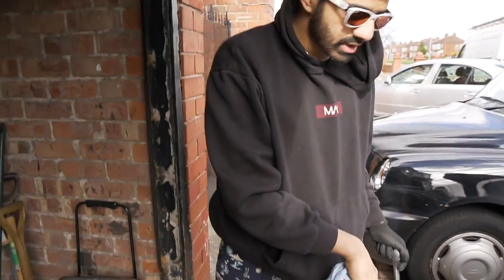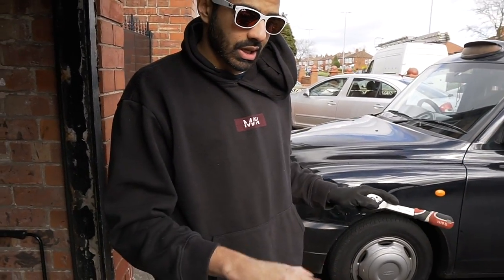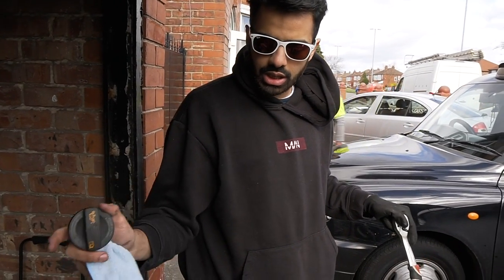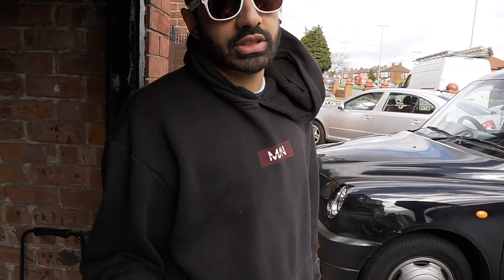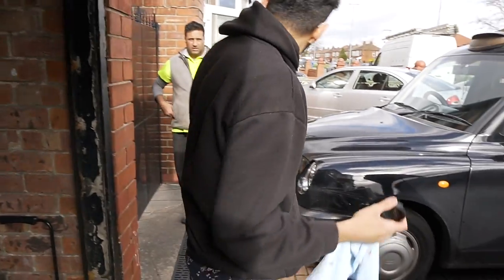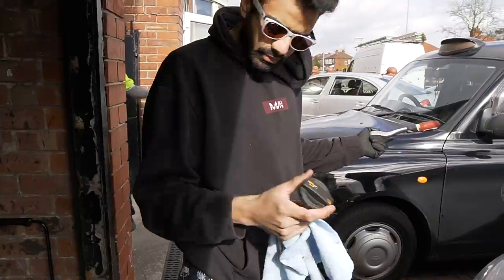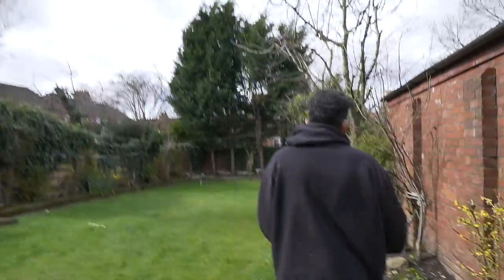We shall go pour this, and we'll come back and top it up. But remember, the car is on jacks, so you want to jack it down again, then pour the oil. Now the car takes about 3.7 liters of oil. Don't put 3.7 liters of oil just in it. Don't be a dickhead, bro. Right, so we'll go do that. Get back to you. Keep moving on.